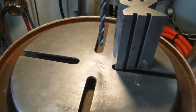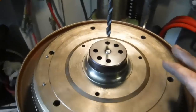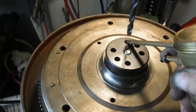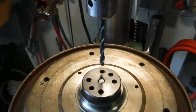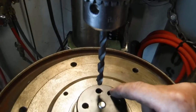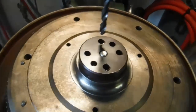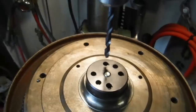You want it to fit when you're done. Looks like my flywheel just fits on that surface just right. Now I'm going to take a little bit of oil and put it on my drill bit and put some in the hole. You can see you don't have all eight holes here — one of them is offset. You use two of your best holes, drop the extended dowel pins that they give you in the kit, and you screw this and it centers. This thing is sweet. I'm sure some guy is going to tell me he did it with a hand drill, and I'm sure it's been done before that way. But if I've got the tools, why not use it?